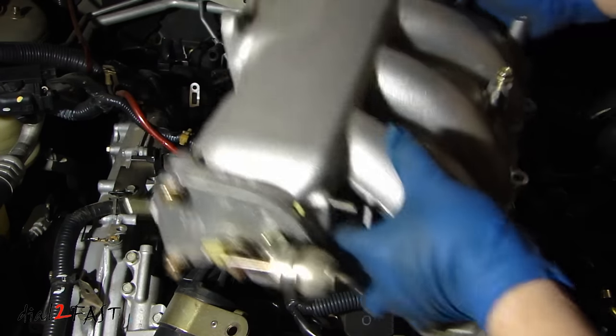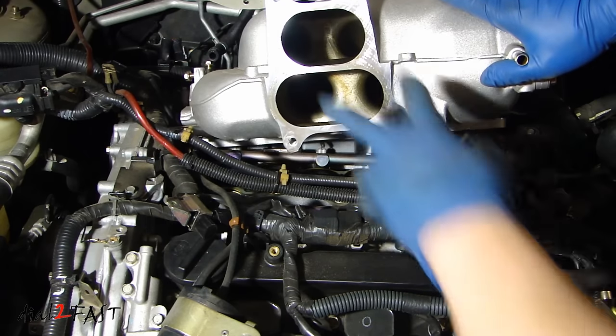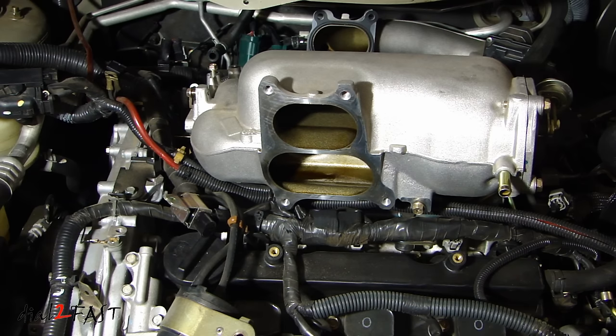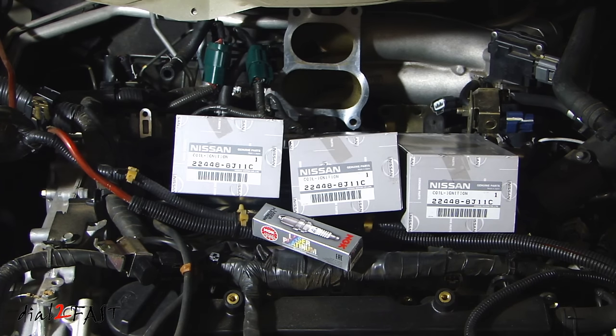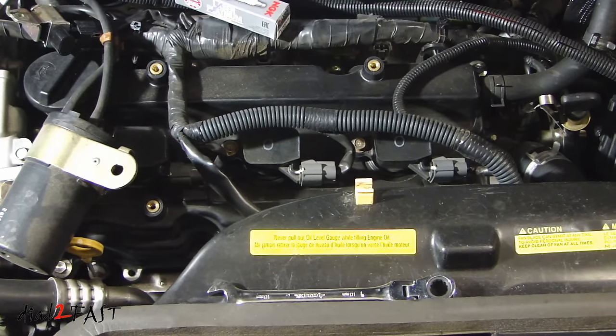Here is the other lower plenum — let me turn it around so you can see what the back looks like. We have the two top bolts and two bottom bolts. Now this bolt here is for a bracket that holds two green connectors at the back. If this is the first time you are doing this job and nobody else has worked on it, you need to remove this bolt and take that bracket off the plenum, otherwise the two green connectors are still going to be attached. Since the removal of the intake plenum is very involved, I'm going to go ahead and replace all three of the ignition coil packs. The other ignition coils on the front side are very easily accessible, so if they pose problems later I can replace those very easily.